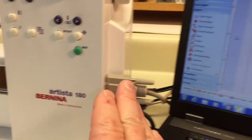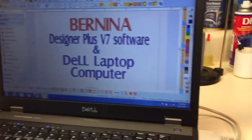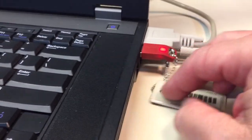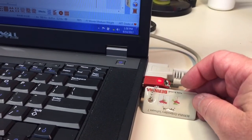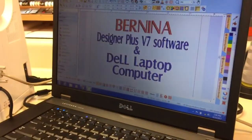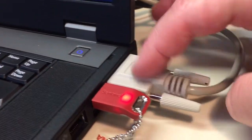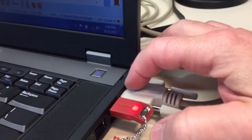The reason for this video is to show the older Dell laptop that I am including along with this Bernina Designer Plus software. The software tag will say 'update' because this was full version Bernina Designer Plus V6 and it was updated to V7. This is fully functional, fully updated software. The advantage of getting an older computer like this for owners of these machines that do not have a USB port is that this machine has a COM port, and I have the regular DB9 type COM port plug plugged right into the computer.